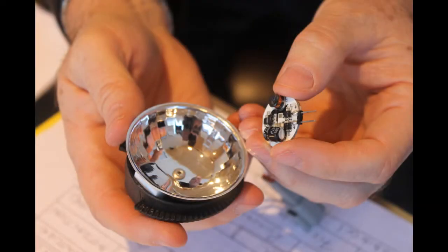There's the standard halogen bayonet bulb, and I'm just going to pull that out. Normally you wouldn't touch these with your fingers if you were putting a new one in, because the oils from your skin will overheat the bulb very quickly and the bulb will fail. You don't have that issue with the LED replacement. Here's the LED replacement, and it has the same bayonet on it.